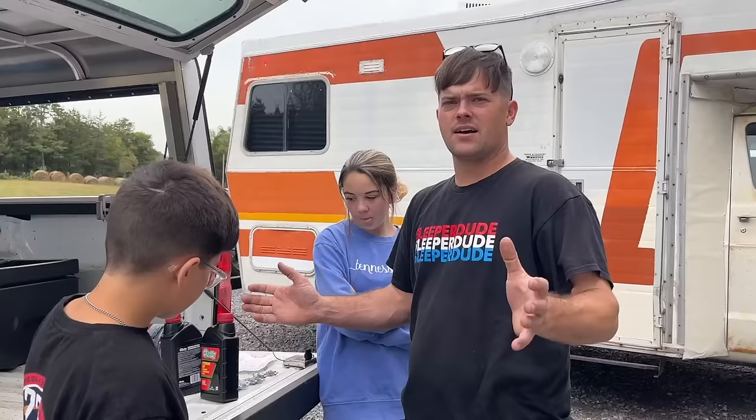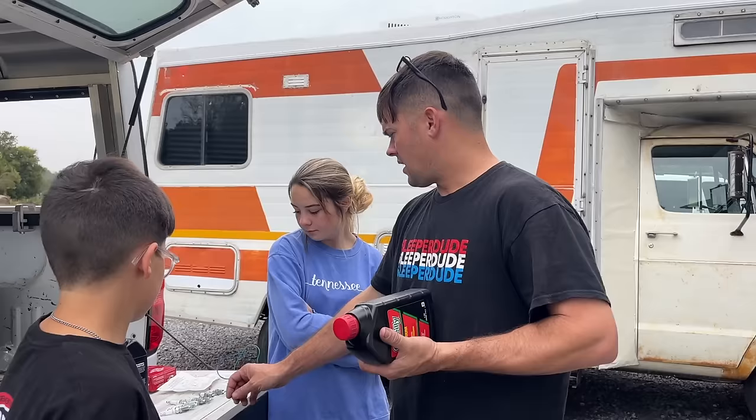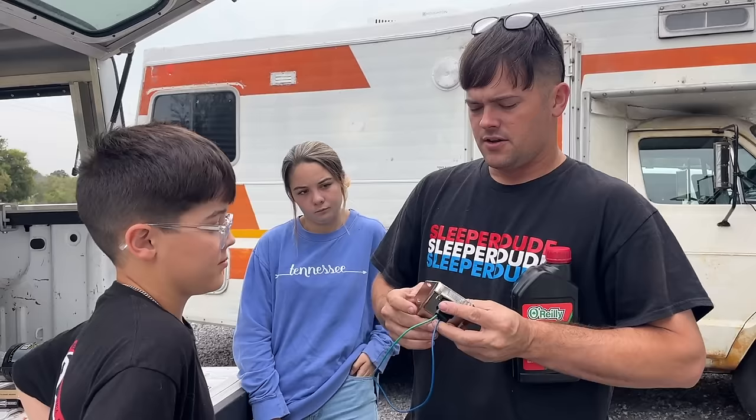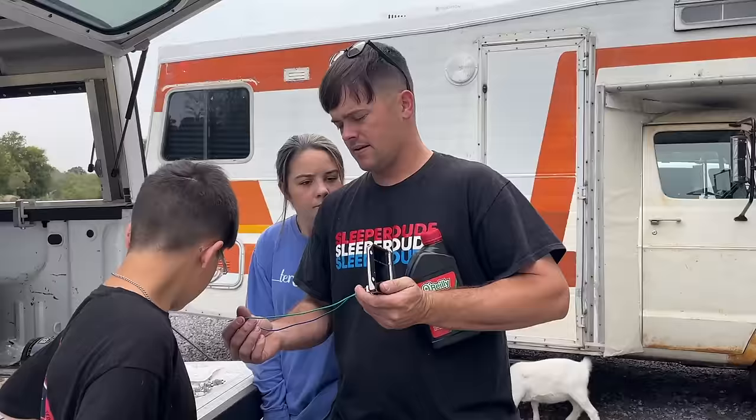Woo! All right, it's the next day. We went to the parts store. I got a banging haircut. I went ahead and got some new spark plugs because our other ones looked really fuel fouled when we took them out. I also did some Googling and talked to Mr. McCool about the whole voltage regulator deal. Supposedly the old Dodge voltage regulator will work for regulating the voltage on that new alternator. Looks pretty simple, just a two-wire deal.